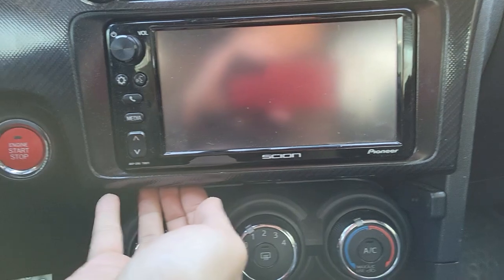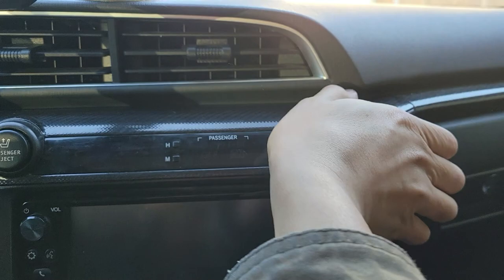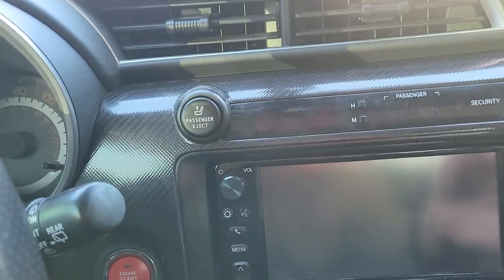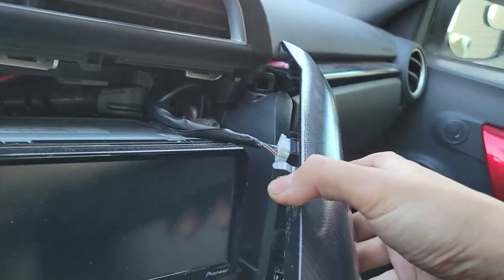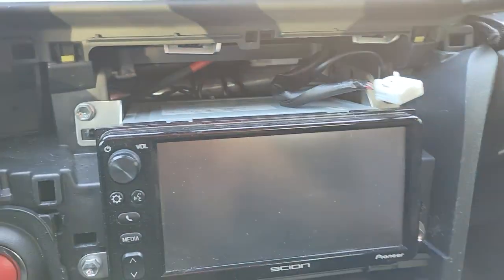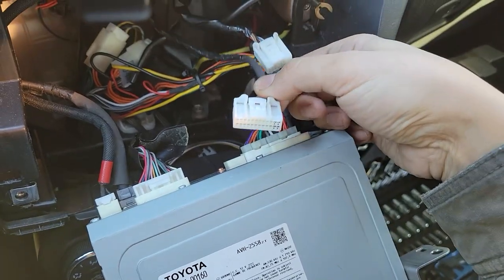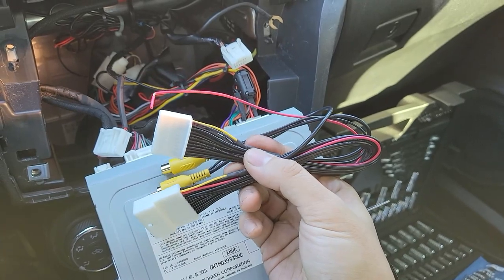The first thing we want to do is remove the bezel starting from the bottom. I've actually been waiting for it to get warm enough to do this after a wire got pulled out from the harness I got from the camera source. I could try to fix it again, but this gives me an opportunity to show you an alternate harness you can use. Now we just need to unplug this and then take the bezel off. The head unit is secured with four 10 millimeter bolts — you'll need a socket extension to get them out. Here's my old damaged harness, and now I'm going to plug the new one in place and wire up everything to make sure the camera works.